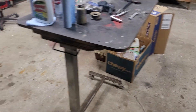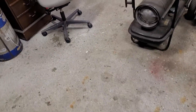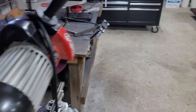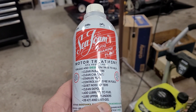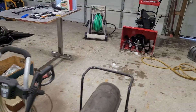If you have any questions or concerns, give me a call at 731-298-1702. It's wintertime, and for all your snowblowers — whether they be a four-stroke or a two-stroke engine where you have to mix oil and gas — use Seafoam. This is going to reduce the amount of moisture getting into the fuel system and will also keep fuel lines from freezing up.